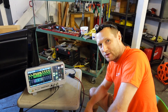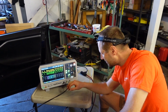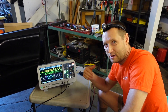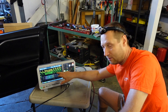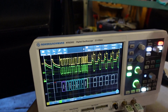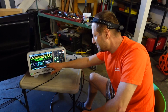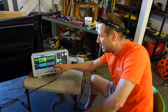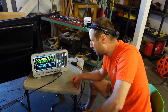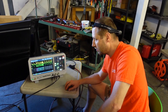We connected to the powertrain CAN bus and right now we can see a CAN bus signal with some noise. You can see there are strange changes on the signal — it cannot be recognized or decoded. It looks like there are problems with some module on the CAN bus. We have to figure out and investigate.